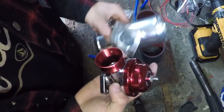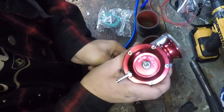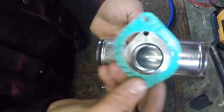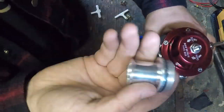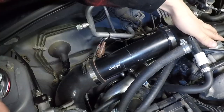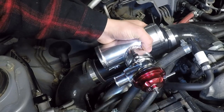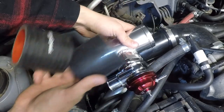Before we install this stuff on my car, I'm going to have to replace this with this, and I'm going to have to install this on this. Here's the throttle body right here — this is where we want the blow-off valve or bypass valve, as close to here as we can get. I'm going to install it right there. Thankfully I've still got a couple of couplers left from my intercooler piping, so I'll be able to just hook this right in line there.